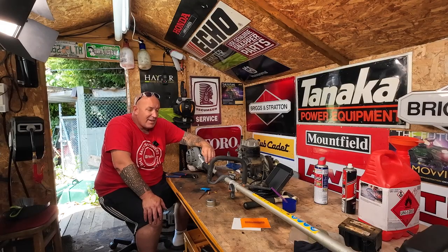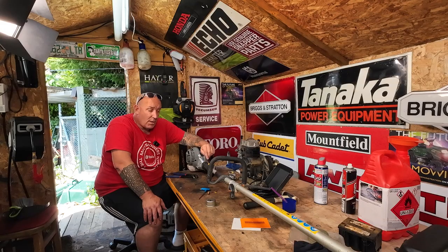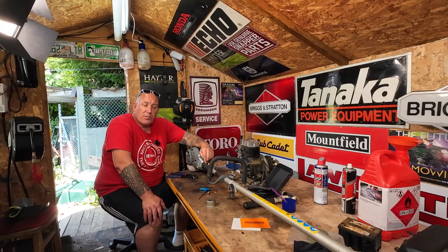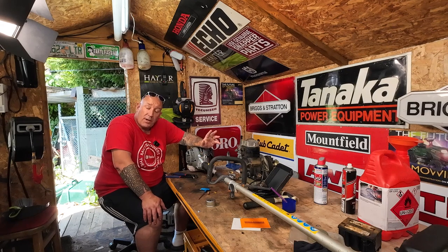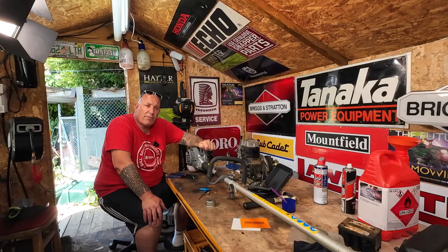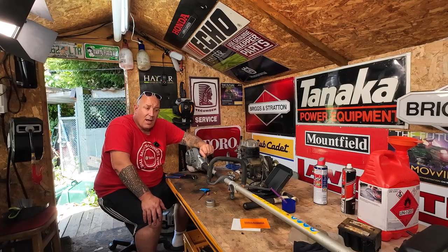I've had this machine about three years now, I think, dependent on my very first unboxing video I did of this. This is the first time I've actually had to do anything with it, so after three years that's not too bad. People experiencing problems after three years would normally just throw this machine away and buy another one or send it away to get fixed. But I'm gonna try to fix this myself. I did a video about three years ago on how to fix it just by replacing the carburettor, but today I'm gonna show you how to replace a gasket and diaphragm set, rebuild the carburettor, and hopefully get it up and running for a lot less.